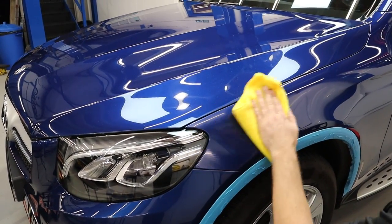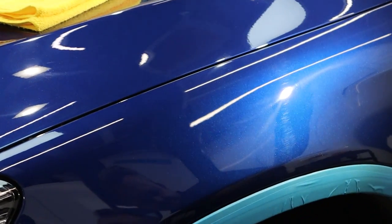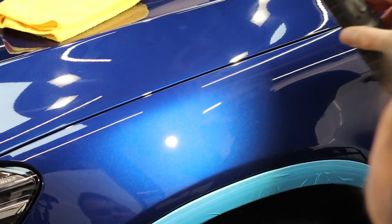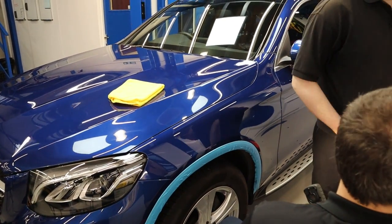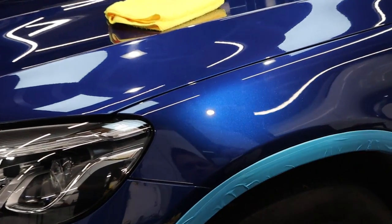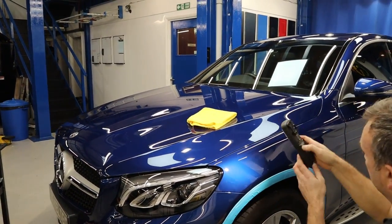I'll pull the tape off and wipe it down carefully. Getting the light on it — you can see there's an improvement already. We've got swirly holograms there, and then you can see the correction. There are some slightly deeper marks — one more pass with that would fix them — but for a medium polish and medium pad, that's impressive. We'll IPA it, because there could be fillers in compounds left behind. After wiping that down, you can see there's not that horrible hologram finish. That's a great enhancement. Now I know that works, I could have worked it a little longer with more speed and pressure to get a better correction rate.